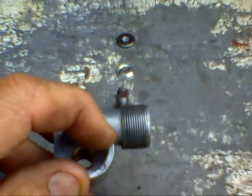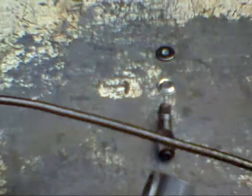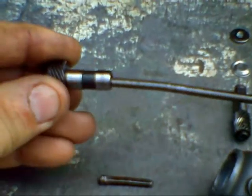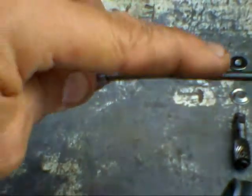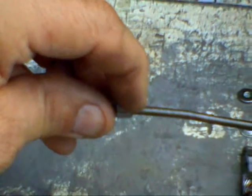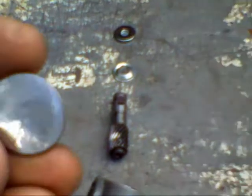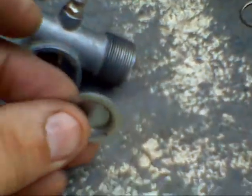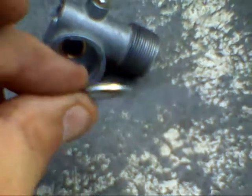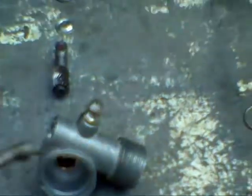Now, you knock these four dimples off and then you can press it apart. On Ferrer's, the spur gear still had the cable attached, so I used a small socket so the cable could protrude through where the wrench usually goes. That pressed on the end of the shaft, and you just put it in your vise. What will come off first is the plate that goes in the back. Then as you continue pressing it out, you have this little tensioning gizmo. That will come off next, and as soon as that comes off, your spur gear will just slide right out.